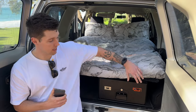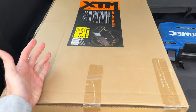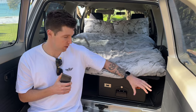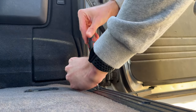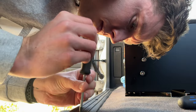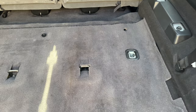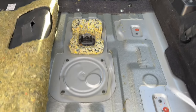In terms of the installation, the first thing I did was install this drawer. This is an XTM drawer that I got from BCF. The drawer is actually fairly simple to install. In these GU Patrols, the first thing you do is remove this front strip. The front strip has a couple of Phillips head screws that you have to take out, plus some clips as well. Once the strip is taken out, you can lift up the carpet to get underneath to access the bolts or the mounting points for your drawer.